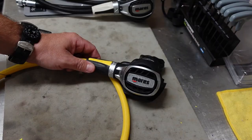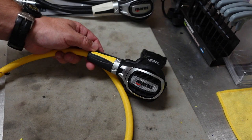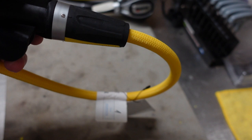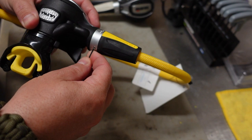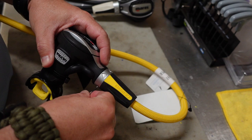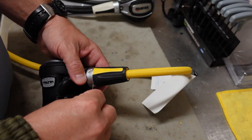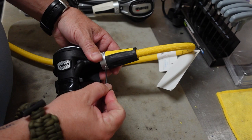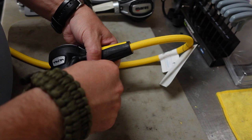If we take an in-depth, closer look at the twin power system here, you will notice that there's a little tiny allen head screw there. All you've got to do is get an allen head that fits that screw, line it up, and simply start backing out that allen head. Now it's not spring loaded, but what I will tell you is when you take enough of these out, you'll learn that they do kind of go flying. So you want to be very careful. One of the reasons we use these rubber mats here is it kind of catches parts as we're taking them apart. But you just want to get it backed out. Once you get it started, it should come right out — and that's that little allen head screw that you pulled out there.